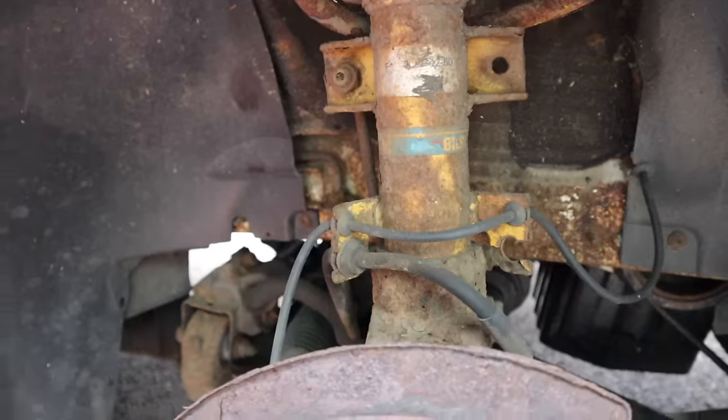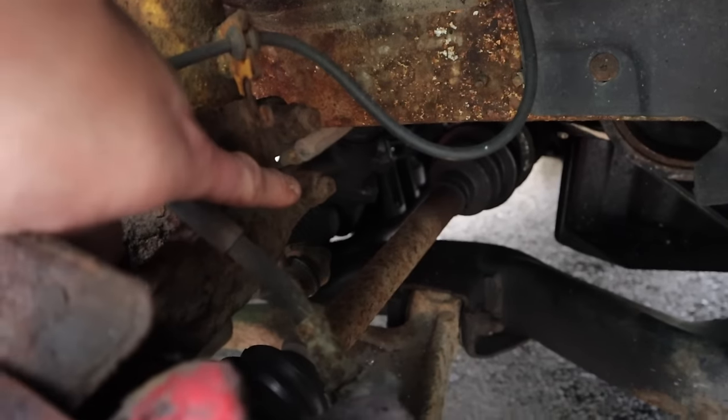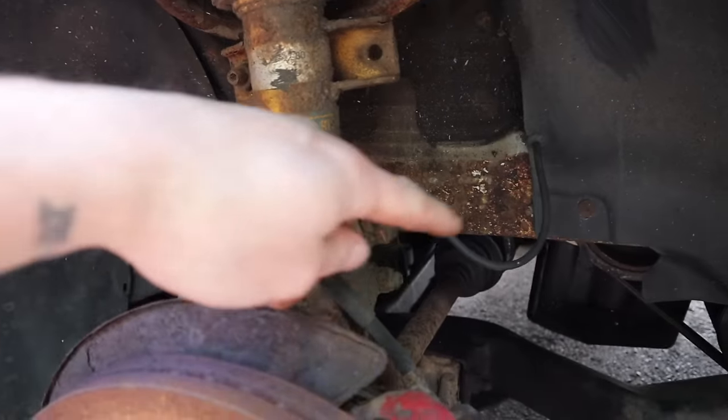What we've got to do now is unclip this and spray some lubricant across it all. We've got these two bolts at the back - this is a T28. The T28s have bolts at the back and the strut slides into the hub, and the hub wraps round it and tightens onto the bottom of the strut. If it's a T32, I believe you've got two bolts at the front, so the hub goes into the strut and bolts in that way. But because it's a T28, you've got the two at the back.